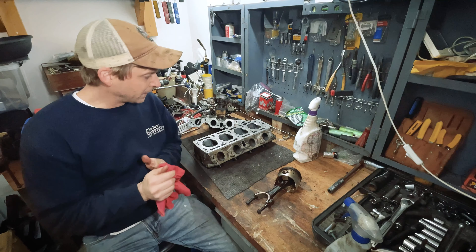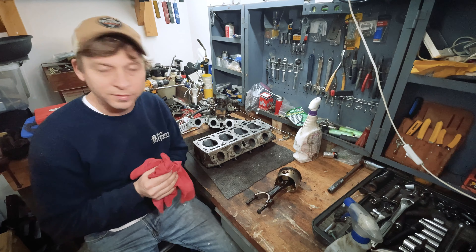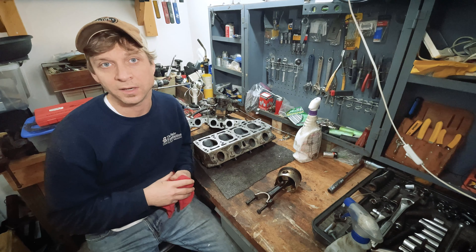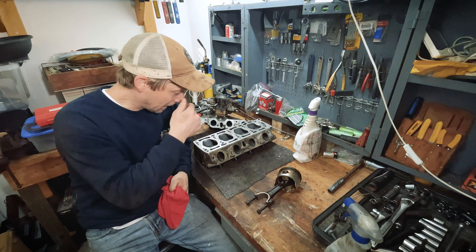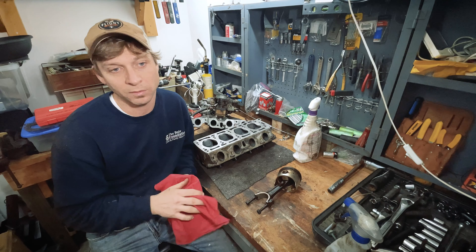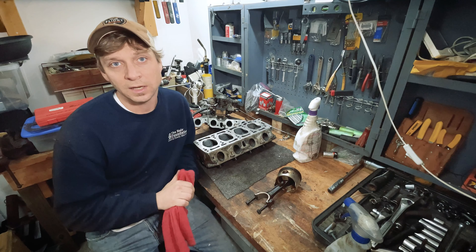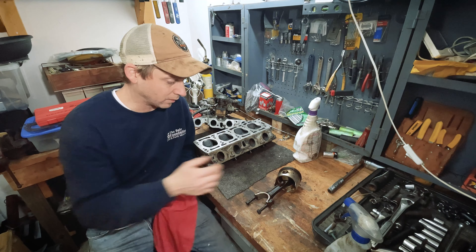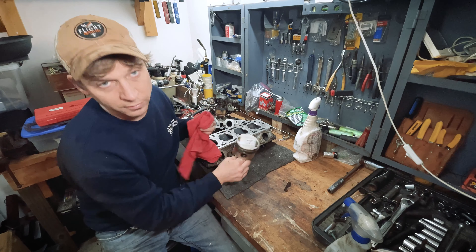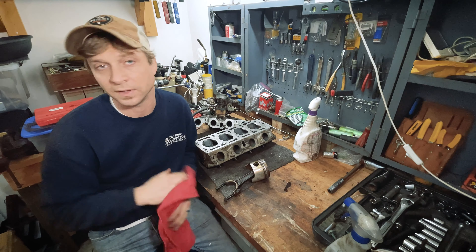Let me get you caught up. I cleaned off the new cylinder head that I bought - it cleaned up pretty nicely, everything looks to be in pretty good shape, just a little dirty. I slapped it on, just snugged it down without torquing it to spec. I ran a cold compression test on every cylinder and it went pretty good until I got to cylinder number three, which had zero compression. All the other three cylinders had pretty decent compression. So three was no bueno, and I decided to pull the piston - this is the one that got damaged the most, the cylinder where the valve broke.